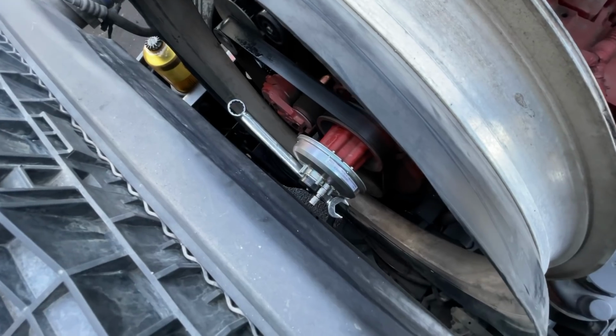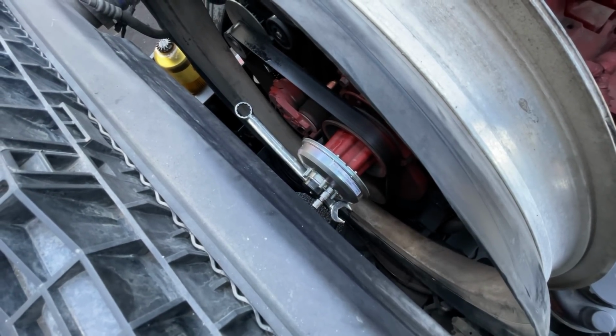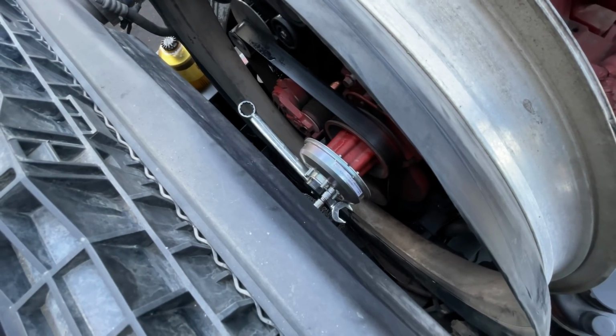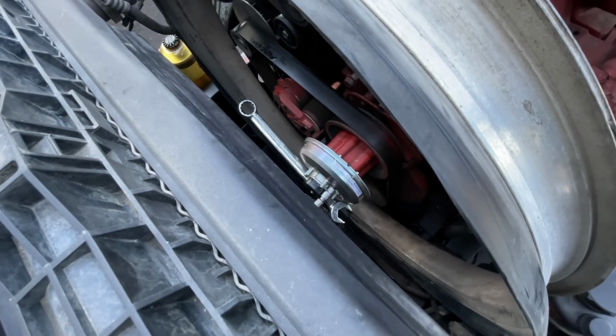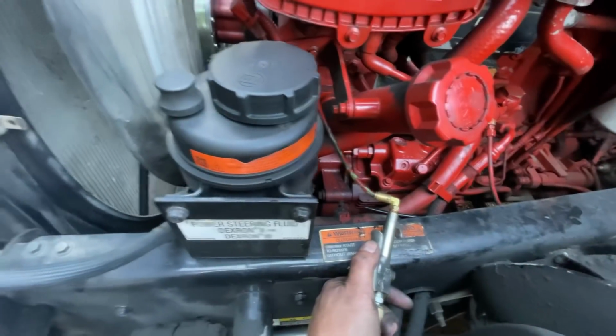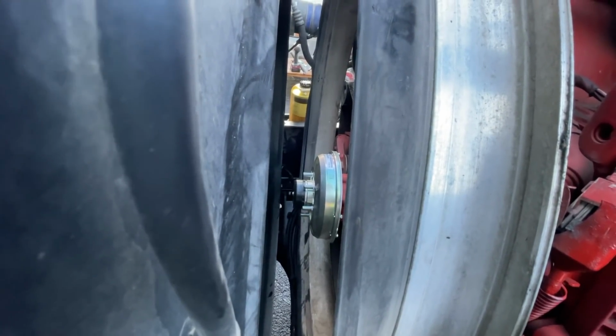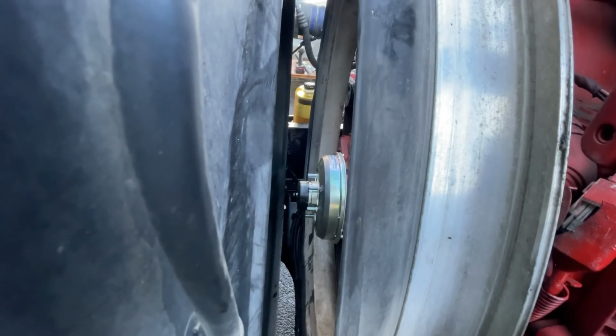So we've got a nice combination wrench in there to hold it still, because it's going to move on you, and try and get 45 pounds out of each one of them and go back and forth side to side. Don't just go one after another. Here we go. Okay, moment of truth. We are torqued down. No air leak. Awesome.